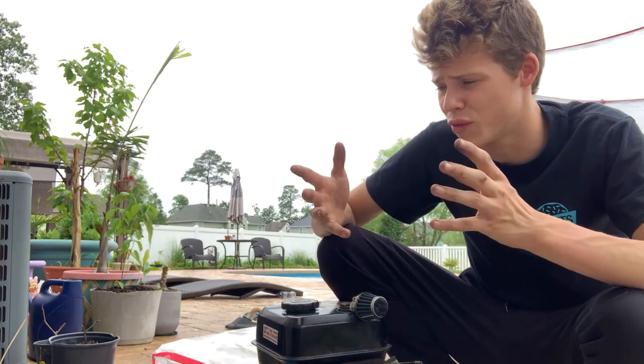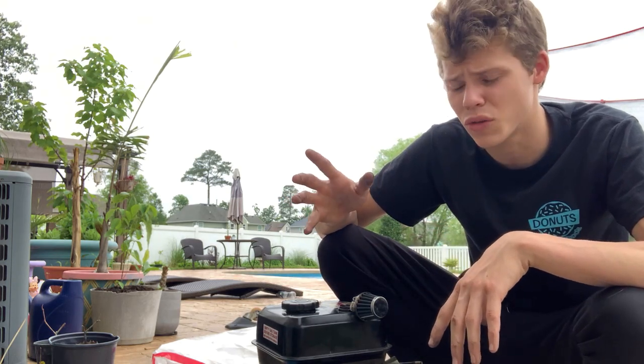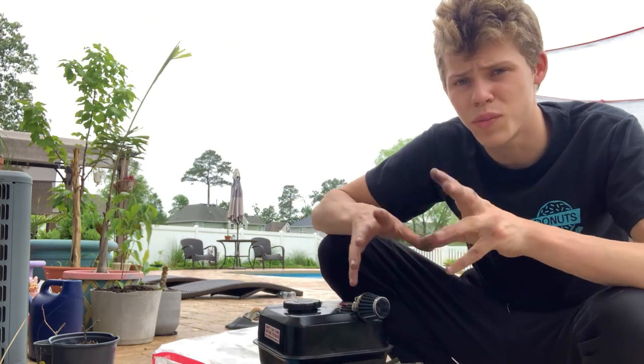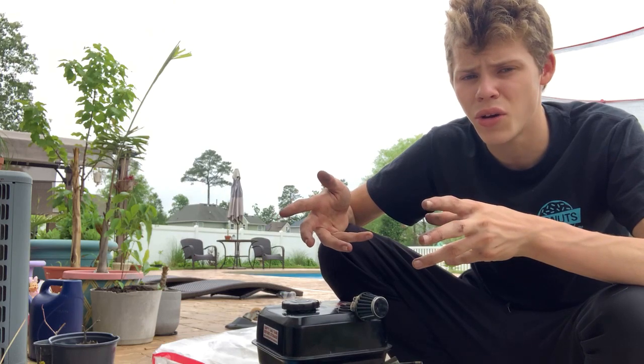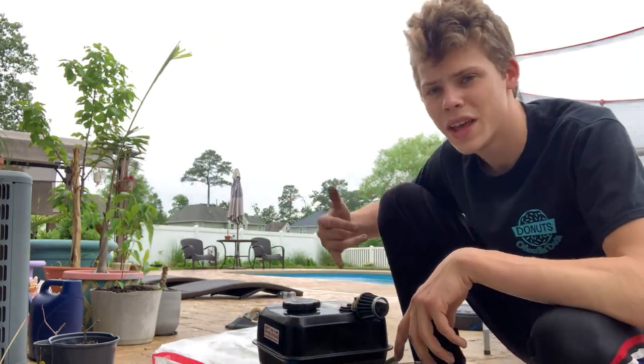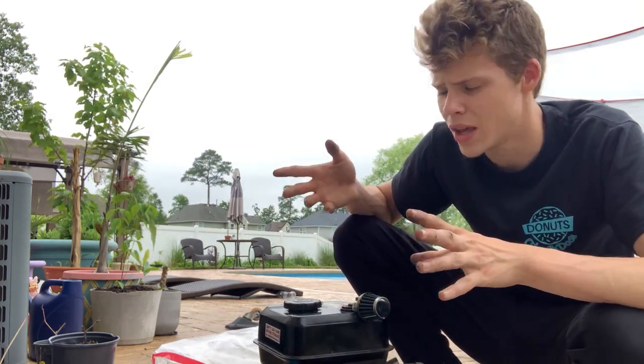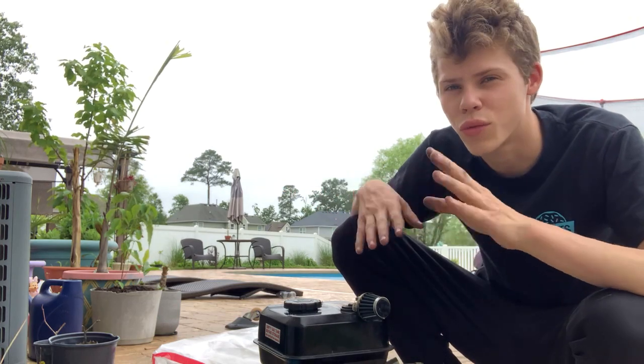So if you give it too much power, the valve is probably going to fail first, probably going to get valve float if you hold it at high RPMs for too long. So definitely don't hold it at max throttle for a long time, or if you've been driving pretty fast for a while, give it some time to cool off, like just idle for a bit or turn it off. Don't be out there driving around for like 15-20 minutes on and off throttle a lot.